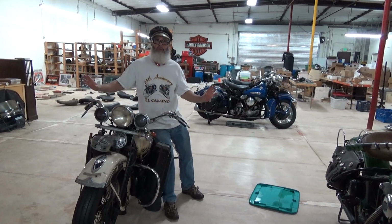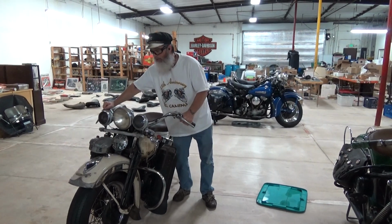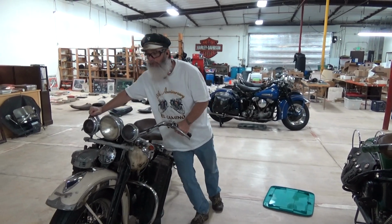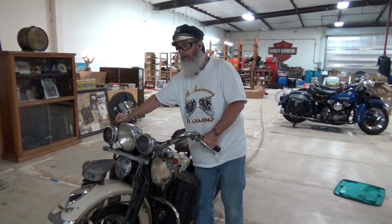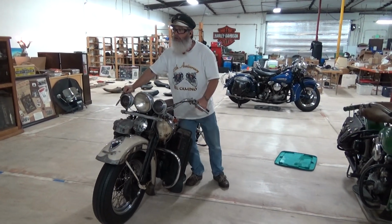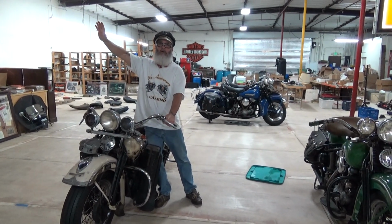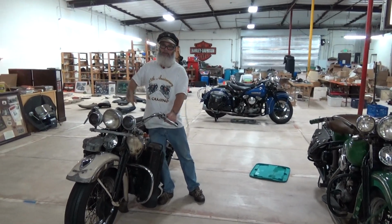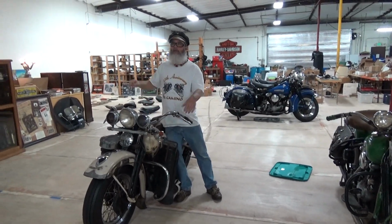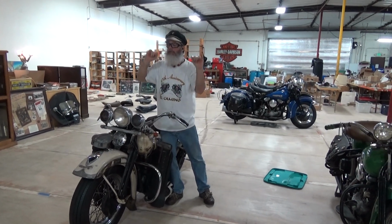You lean it into yourself, and you lean it into the bike. You got total control. Now the other way is you're off the bike, and you cock the front end a little bit like this, and you push it, and you steer it where you need to go, and you're pushing with your legs. Now unless this bike's got stupid tall handlebars like this, you can push it anywhere. You got ape hangers on it, ain't happening. You got to push it with your legs sitting on the seat because you don't have any push muscles to control anything up here. But there's another way around it.